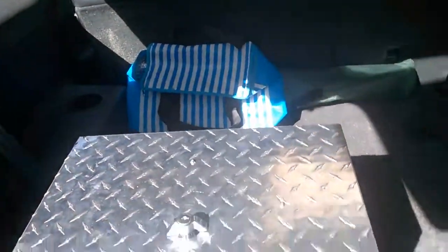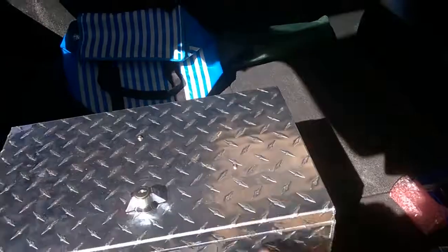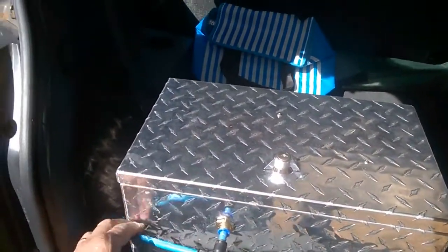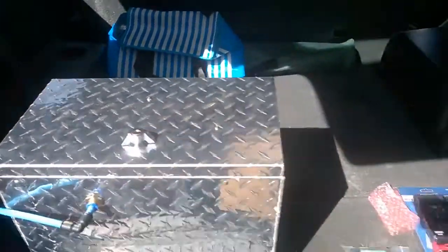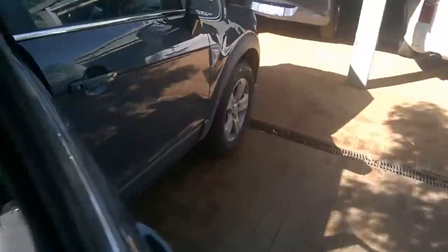The whole thing is lockable and can be tied down to the rear of the vehicle with a strap which goes over the top of the box, quite cleanly and neatly. The gas from this comes through 10mm trucking air brake piping, which runs under the underside of the vehicle and comes into the intake manifold.